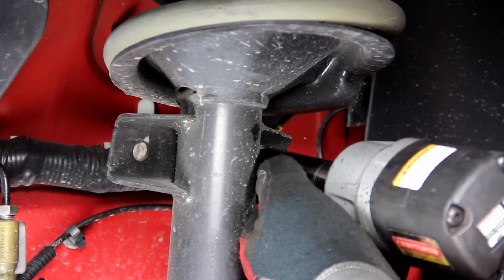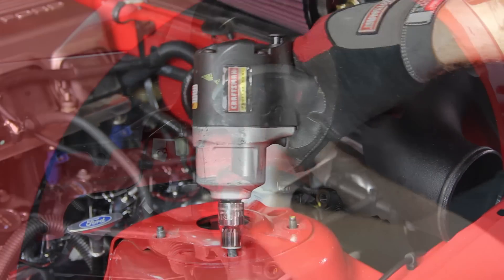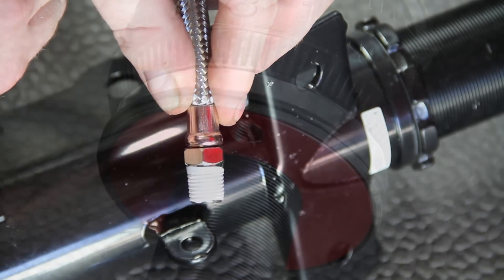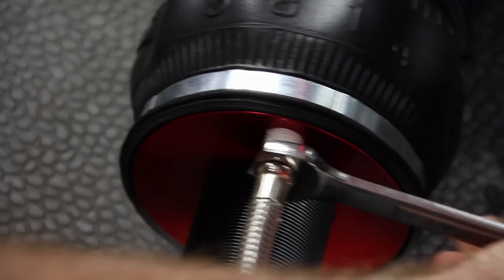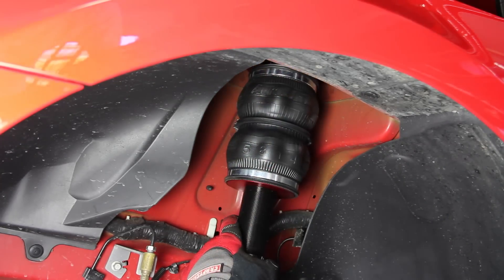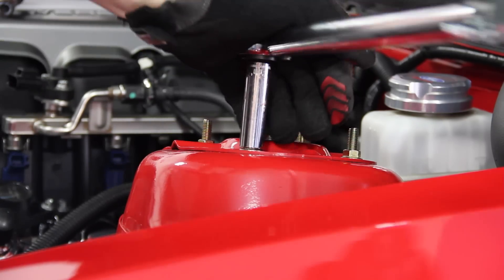Starting up front with the vehicle on jack stands and wheels off, remove the bolts to free the strut, the bolt from the brake line tab, the sensor wire, and free the stabilizer link. Then under the hood, remove the nut holding the upper mount to pull the strut from the vehicle. To prepare the strut, apply Teflon tape to all threads of the braided air line, then thread it into the lower end cap of the air spring, torquing one and three-quarter turns beyond hand tight. Add the air fitting to the other end the same way. With the air line connected, insert the strut back into the pocket with the notch facing outward, secure with provided nuts torqued to 18 foot-pounds, then reinstall the bolts, stabilizer link, brake line, and wheel. Repeat on the other side.